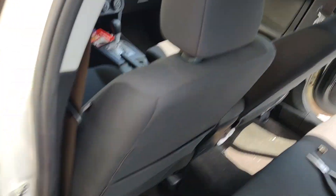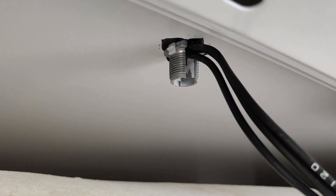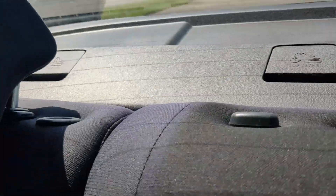There are two tabs on the actual antenna part — that white piece right there — one on each side. You have to press that and then push up to release the antenna. I should have noted that it's a lot easier to look up there if you take off the headrest.